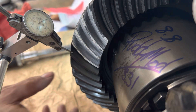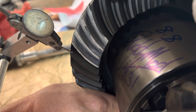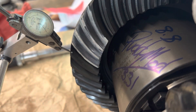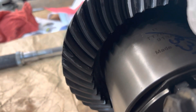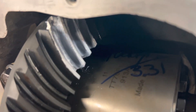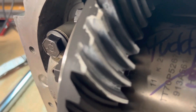We're going to show the backlash on this setup. We're right at seven thousandths, consistent around the gear — seven to seven-and-a-half thousandths. Came out really super good. Great pattern. Spinning it around the other way — you can see the pattern is dynamite on this thing. Really nice pattern all the way across the gear, same on this side.